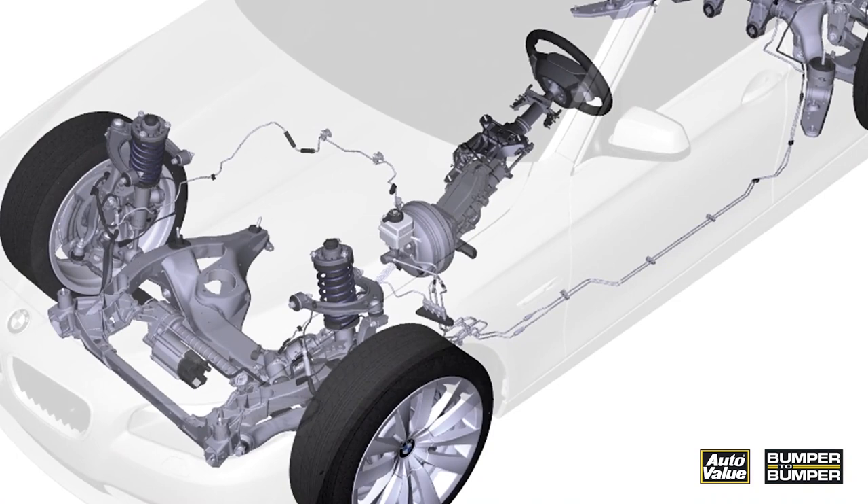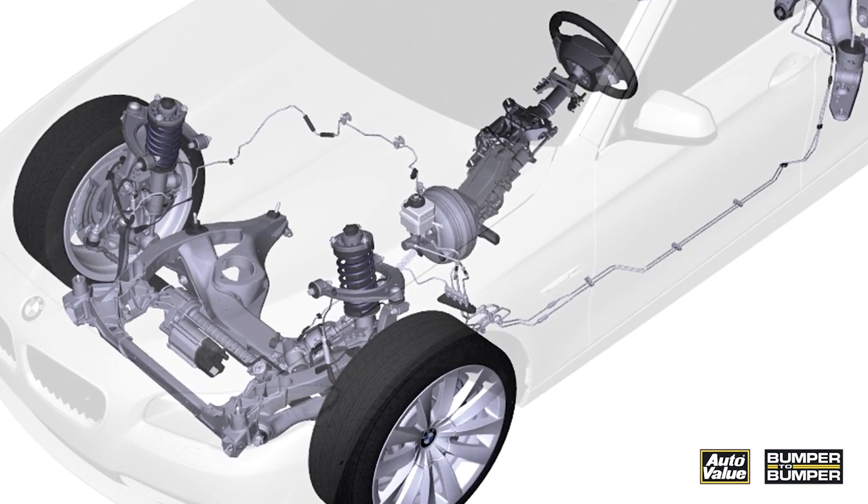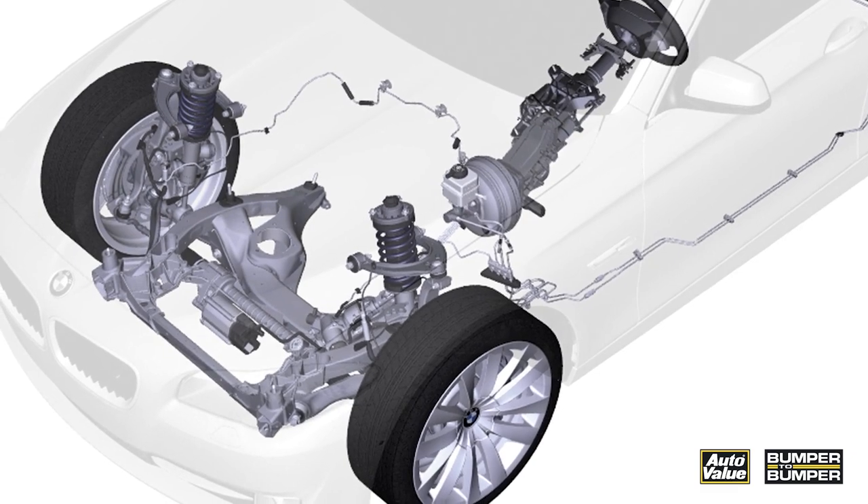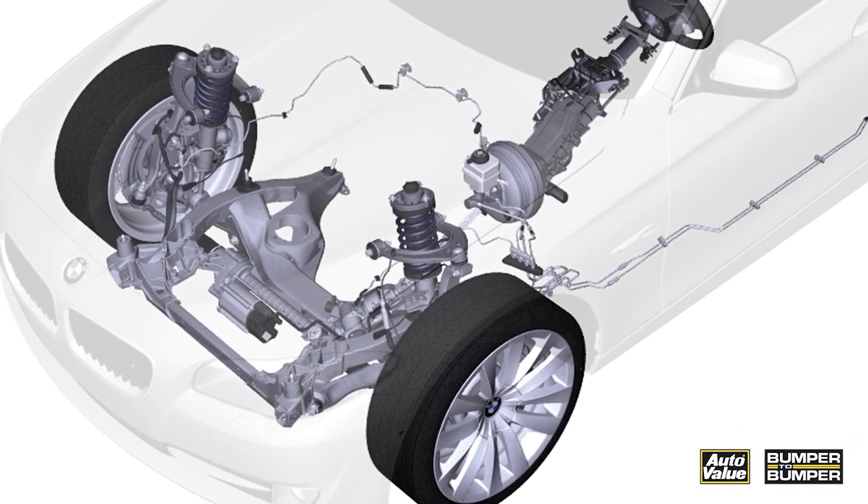This is what changed the brake pedal feel. You have to look at this from the grand equation of the brake system. OEM engineers look at the size of the booster, the master cylinder and its sizing, the calipers, and the size of the rotors — but the one deciding factor is the friction material.